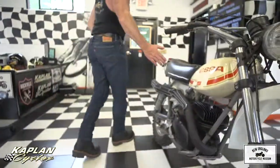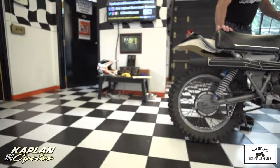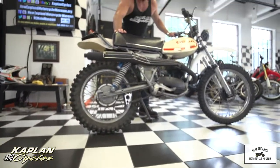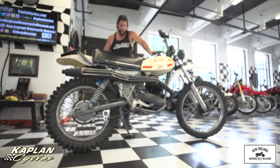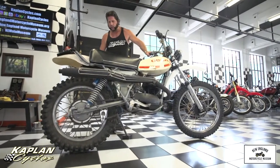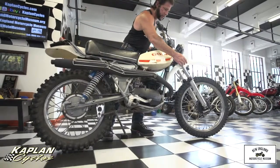It's not running 100% right because of the choke — it's not going to have any air restriction without the air box. But it has perfect compression. The bike's all there. It has an original gas tank, lay-down rear shocks, and beater forks — this is going to need new fork seals.